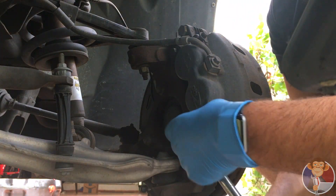Once you put that bolt back into place, you're pretty much done. You want to make sure you get a clean rag and clean off the rotor — whether it's brand new or old, it matters. Clean them up nicely, put the wheel back on, and follow the exact same steps for the other side. After that, you're going to do the bedding procedure for the brake pads, and I will show you how to do that in a completely separate video. I'll post the link in the comments when it becomes available.